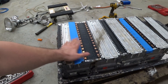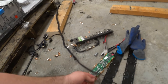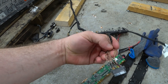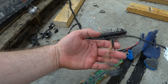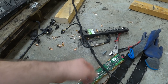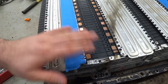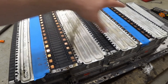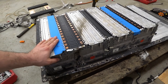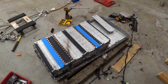Last night I felt sick to my stomach about these batteries, because when I took it apart there was damage to these wires. It got hot enough to actually melt the insulation, which I guess shorted it out or caused resistance. Some of these cells are actually at 0 volts. The whole pack is reading 10 volts per section — all of them were 10 volts — so 30 volts total for the whole thing. It's supposed to be well over 300, like 360 volts.